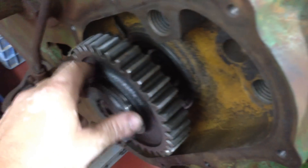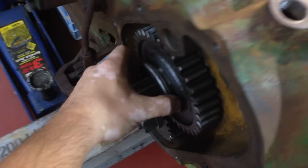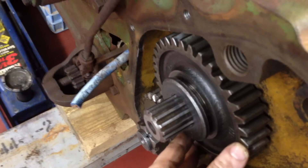So move that out of the way and then engage this gear — that becomes third gear. We disconnect this one, go to high range, and now this pinion becomes fourth. This becomes fifth gear. And then this one becomes sixth gear.